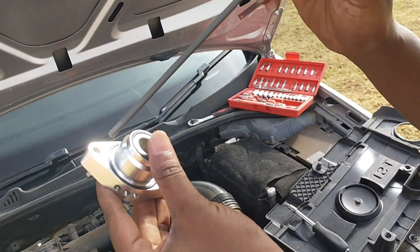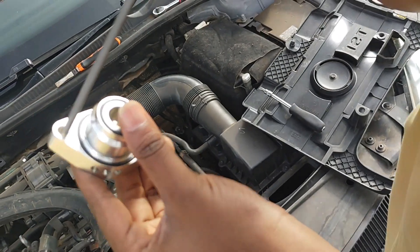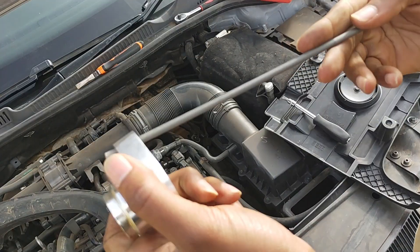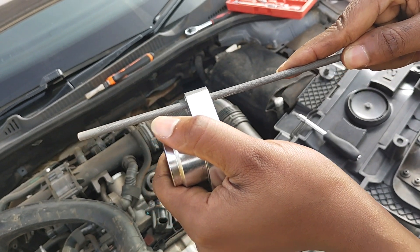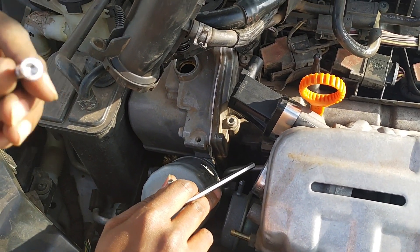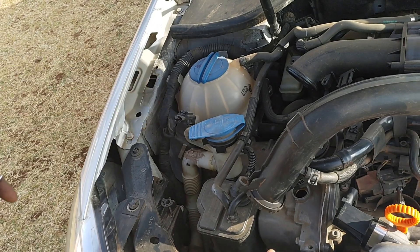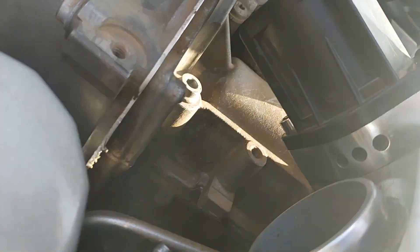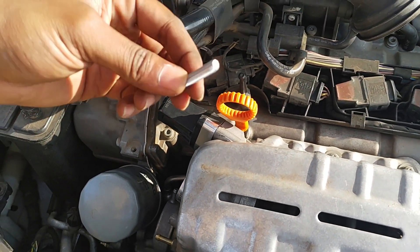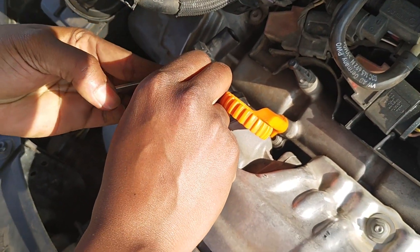Here is my round file. We notice it's the inner side that has an issue, so we are going to be filing towards this portion of the valve. Finally, we've managed to bolt in the lower bolts — it can be bolted with an Allen key, which is a tedious, fiddly job. The bolt is way down there and we are done tightening it. The next bolt is on top over here, which is quite simple to bolt, and that is done.